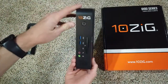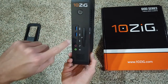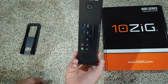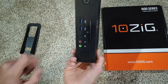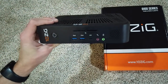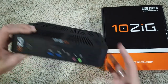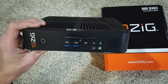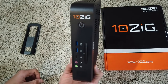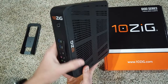These are the interfaces on the front of the unit. You'll notice we've got two USB 3 SuperSpeed ports, a USB Type-C — super handy to have — and then the microphone and audio out. There's also a small slot which is actually a smart card slot. I don't know if the model I purchased has it built in, but that's particularly helpful. You see that a lot in the healthcare industry — doctors walk up to thin and zero clients, insert their smart card, and take over their VDI session from whatever terminal they're working at.